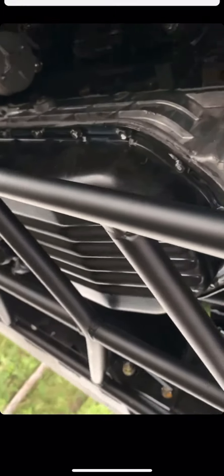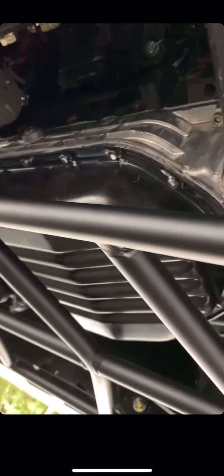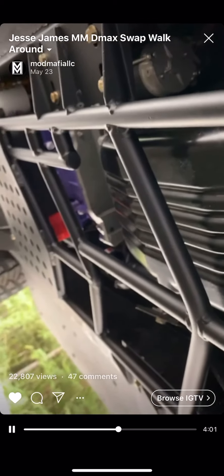One of the many ways we're different from others is we only do the alpha trans, alpha oil lower engine oil pan and upper engine oil pan. This is what they did on the alpha, and it puts the dipstick on the driver's side so it's easy to access and do maintenance. You can see all the extra clearance it gave us — we got to mount the factory undercarriage protection and didn't really have to modify it much around the engine, just take out the little scoop part. Then we mounted the back plate to cover the pan for the transmission.